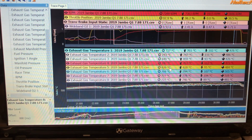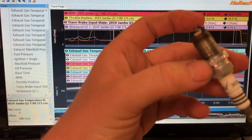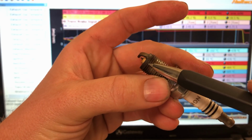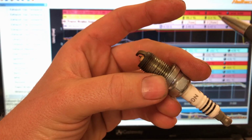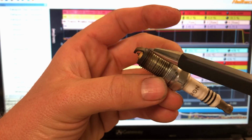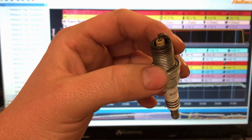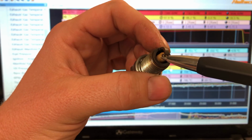So you can see I've got a heap of different plugs here. There's a few different ways that you work on your tune-up, right? These heat marks up the plug. 1, 2, 3. We're just onto the third thread. You don't want to really go much further than that, in my opinion. You can see I don't have a timing mark because I run very conservative. As I said, I don't run a lot of timing. You can see the little burn mark on here.